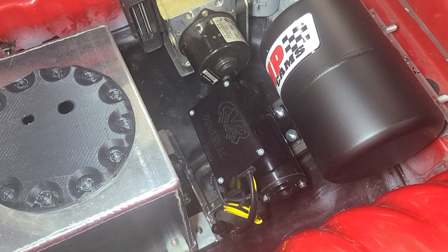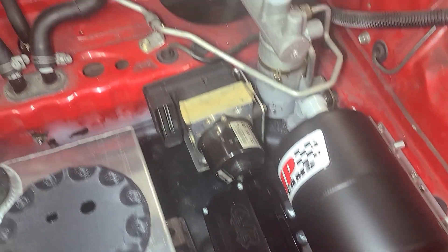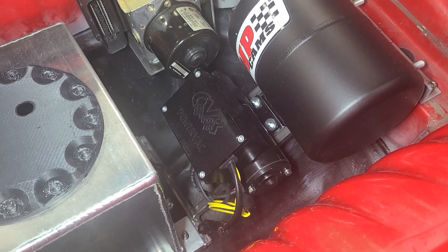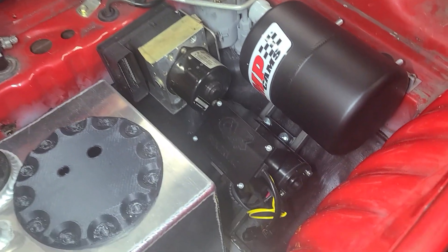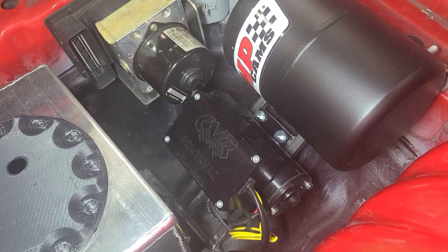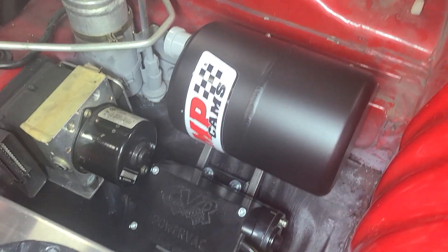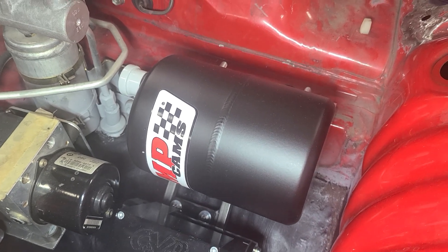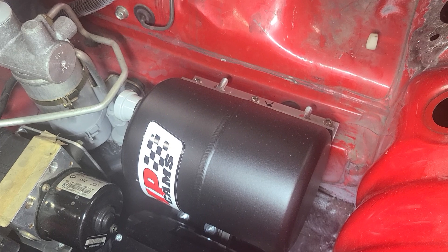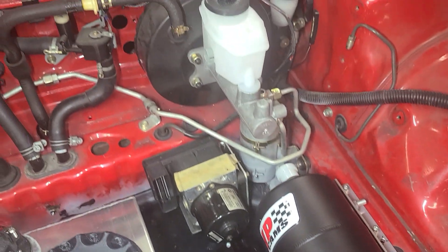I've got a vacuum pump. Because I'll have an anti-lag setup, there is the potential for an extended period where the engine is not making any vacuum at all. Since you've got a brake booster which relies on vacuum to give you power assist, I need a backup supply of vacuum. Most muscle cars with really large cams run into the same scenario where they don't have enough engine vacuum and the brakes are a little lacking. I also have a Comp Cams vacuum reservoir — basically just an aluminum tank — that holds engine vacuum a little bit longer, thereby giving the main brake booster a bit of extra power. All of this helps out with braking.